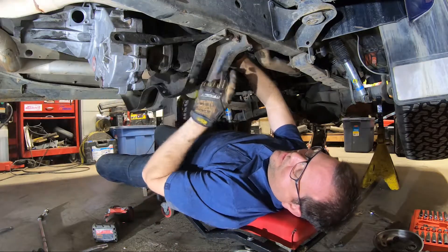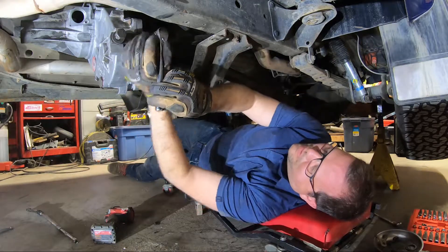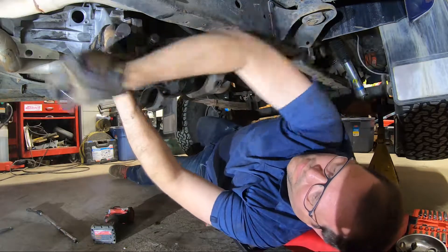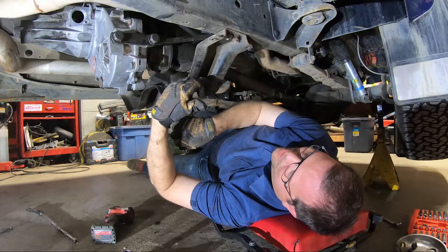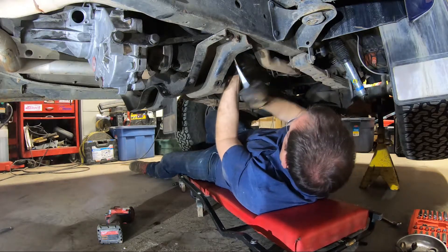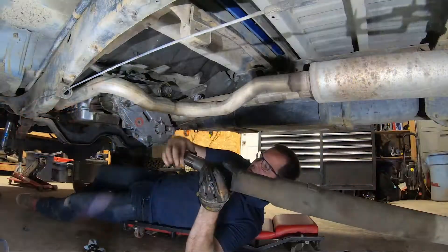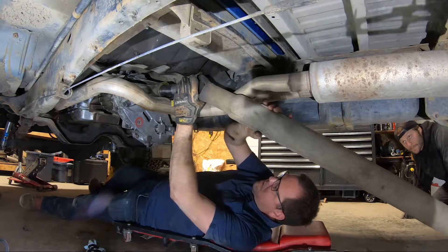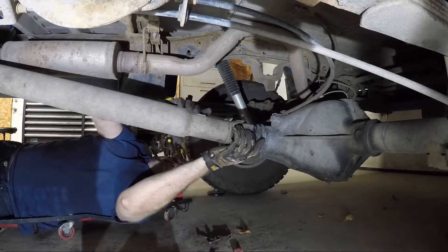As we went to bolt this up, things were a little bit tight as that strut rod goes right to the bell housing. I had to loosen that up at the front just to get full access to these. These holes are slotted, so I'm going to leave these a little bit loose, go up front, tighten that up, and this bar will pull that way, then I'll tighten these up last. Loop that up — you don't need to do too much. Slide it in.